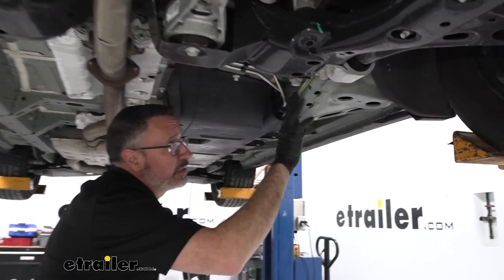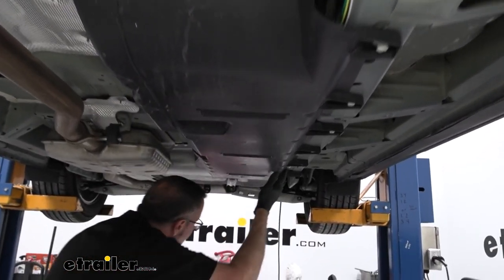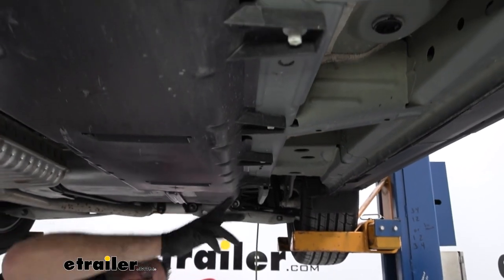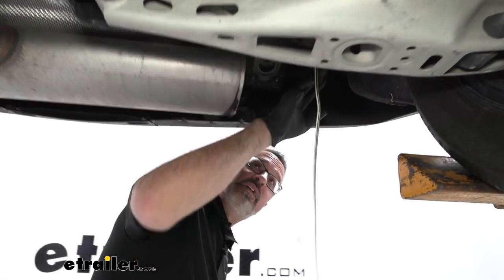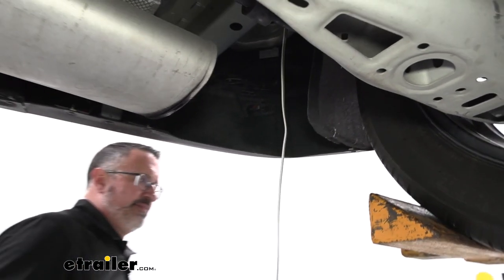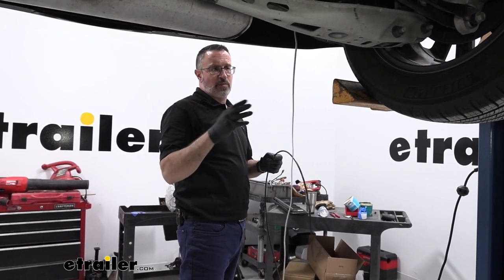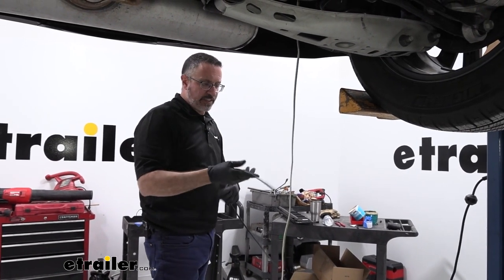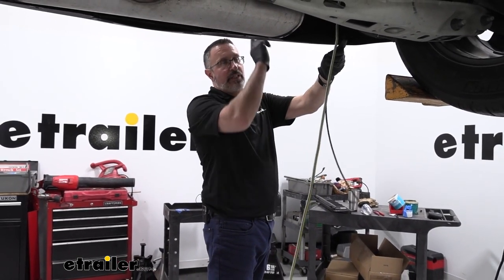We came down the firewall and I went inside this plastic skid pan, this lower panel. It's easy — you can take it off; it's 10 millimeter plastic fasteners and you're able to feed the wire through. It ran up along the frame and then over the wheel arch. When you're routing this, this is just how I did it — you can do it a few different ways, but you do need to end up at the driver's side tail light. Watch out for things that are sharp, hot, or moving while you do that. I've got a section of nylon tubing and this is going to help me fish the wire up through the body panels to the rear tail light.